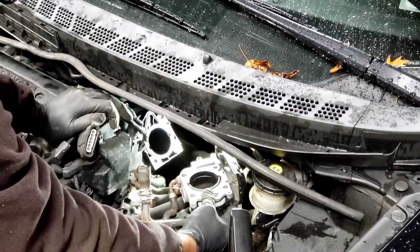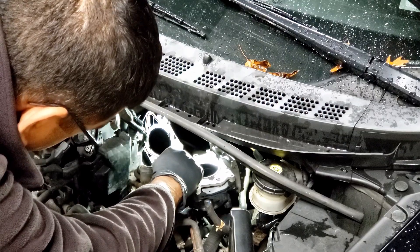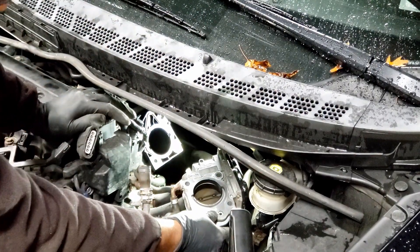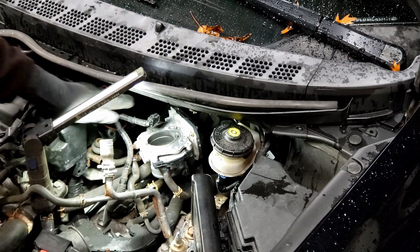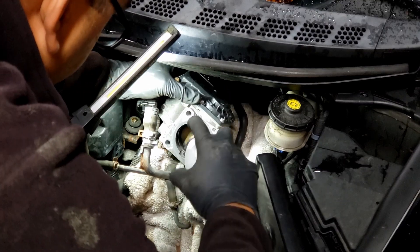Okay, I should be able to just wiggle this thing up. So this is what I was thinking — there's a rubber O-ring around it, it's in good shape, no problems right there. Just twist it like so; we just have to clean right here, the butterfly — that's all we've got to do. Grab some carb cleaner and just clean this thing up.